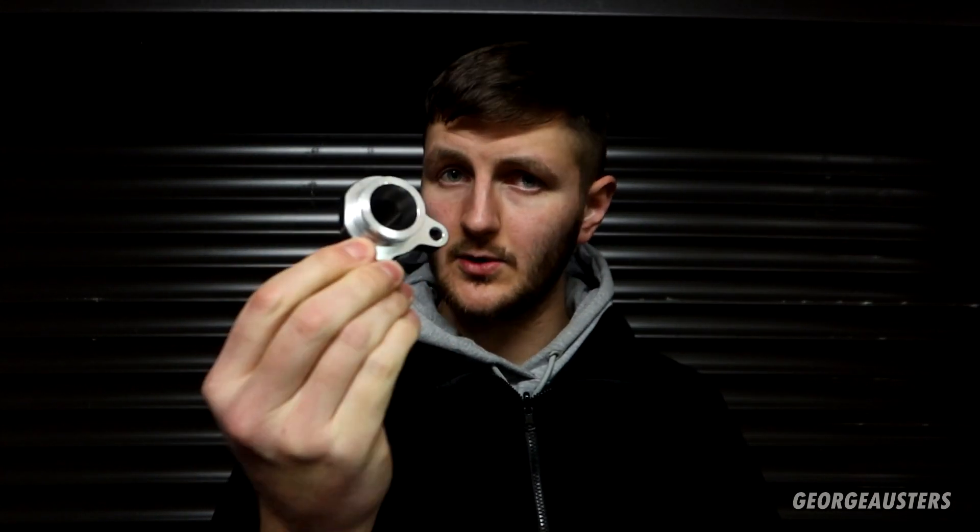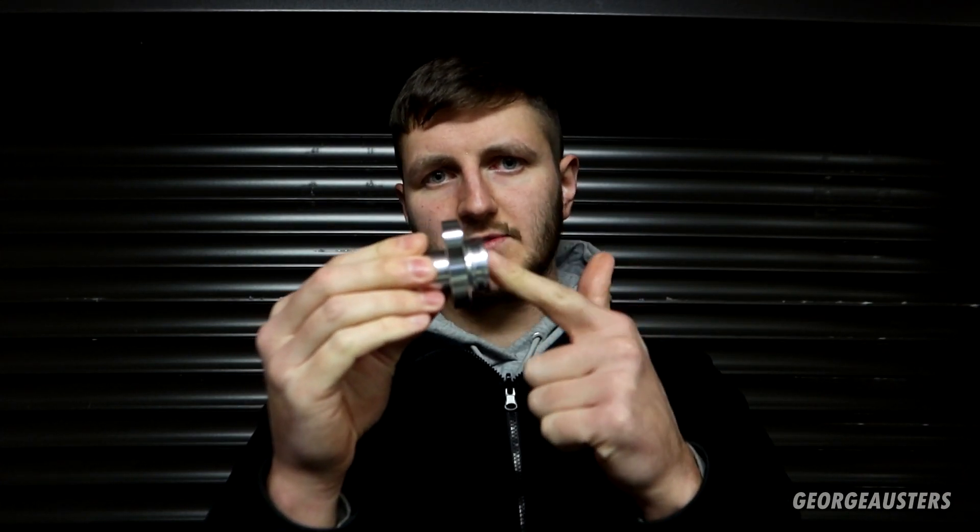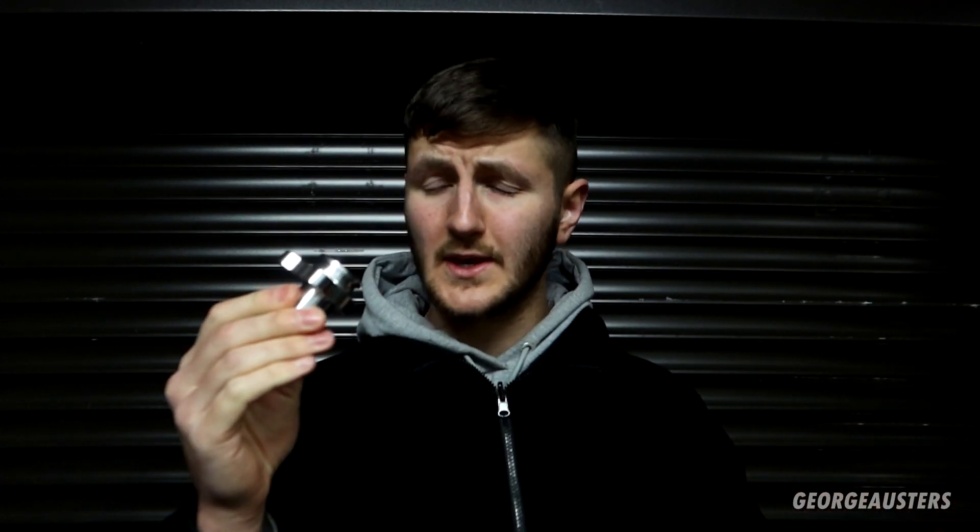I have this to install today. If you don't know where this is on the car, essentially this is a flange for the coolant hose that goes from the cylinder head down to the thermostat. These are prone for failing. The original is plastic — obviously this is an aluminium replacement. The original plastic ones quite literally just fall apart. Mine hasn't got to that point yet, but I know that the o-ring that sits on here has pinched.